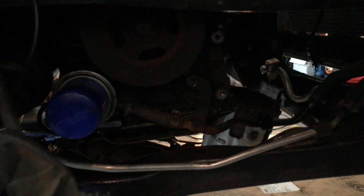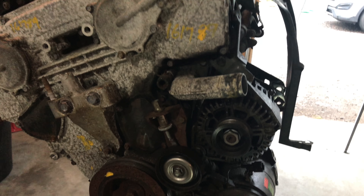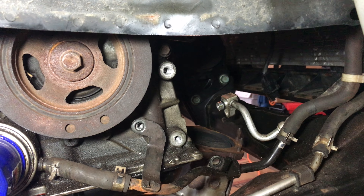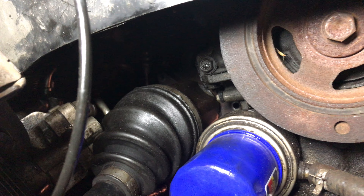Let me grab a flashlight just to make sure you guys can see. So if you notice, I did take off some of the front end stuff — the alternator and the AC pump. I'm going to try to install the motor with them in this time, because the crank got past it so I'm assuming the rest will. As you can see here, I took off the AC and the alternator, so I took the belts off. I also just took off the power steering pump — it's lying right there on the left of the screen.